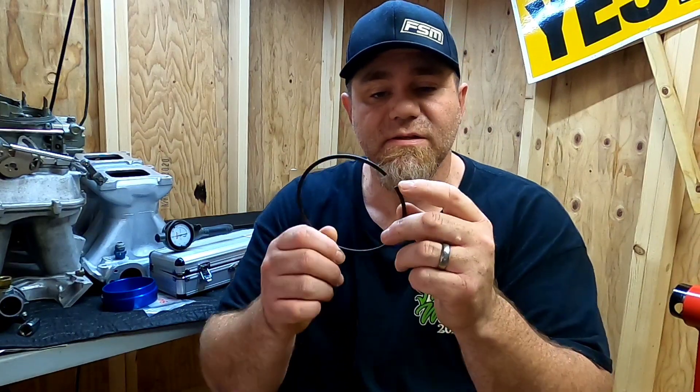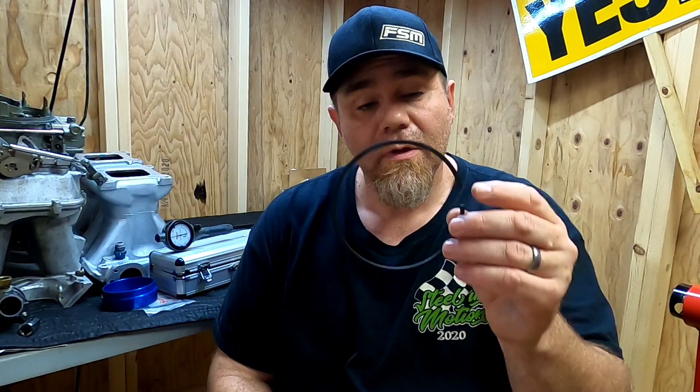When it comes to doing piston rings, this is an area where you really need to be honest with yourself and your intended purpose, because every ring manufacturer has a specified gap that they want you to run for different combinations. If you're going to be doing an NA street strip build, the ring gap requirement is going to be a lot different than if you're going to use a lot of nitrous or boost. So if you're building an NA engine now and planning on running forced induction or nitrous down the road, now's the time to make sure you get this gap right.